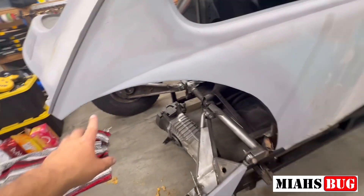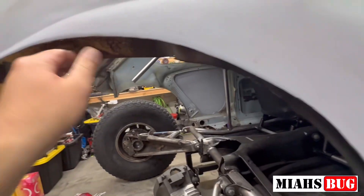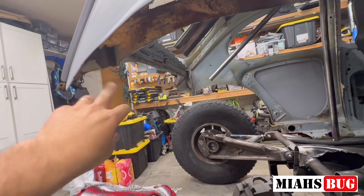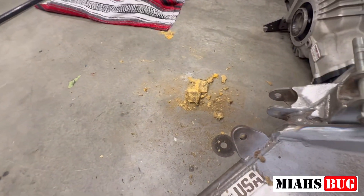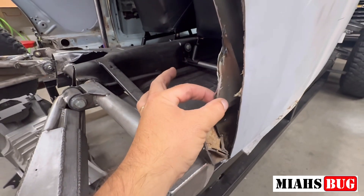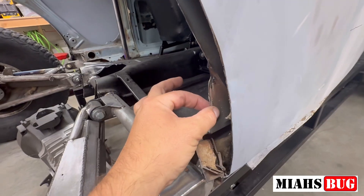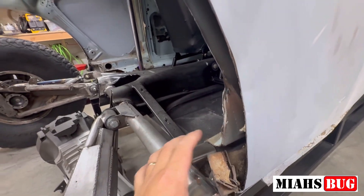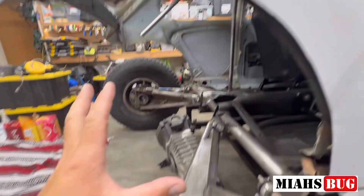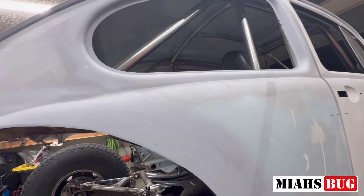This section actually cut out really nice - it's nice thin sheet metal, no problem. Up inside there's a whole bunch of foam, really nasty old stuff that's just crumbling, made a complete mess. There's also a big thick bracket where the back seat belts would go, so it's a little thicker there and hard to get through. Right now I'm just at a rough cut stage, so now I can put my shocks in and see how much clearance I need, then start building my shock tower mounts.